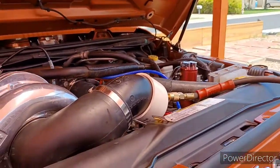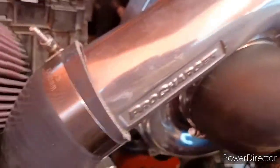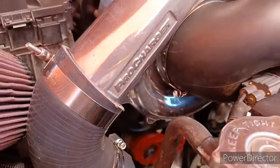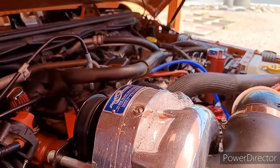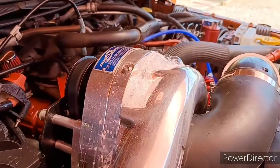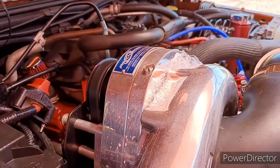Just for starters I ran a quick bead, and I can hear it already coming out here — listen. Then that piece came off; I put too much pressure in. But this is where it's coming out, right here, right in this area. I'm doing a boost leak test and this is where the leak is coming from — the supercharger itself. I think the seals blew in this thing. That's a lot — that's like all the boost coming out right there.